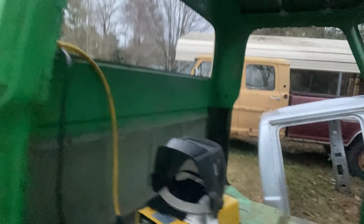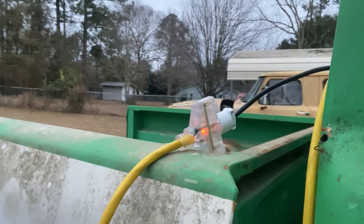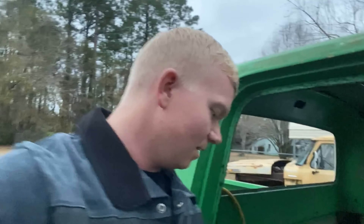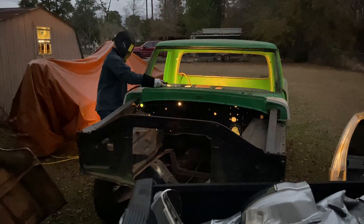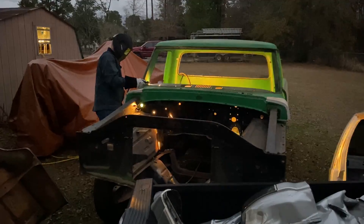I feel like we're in a good spot to start cutting stuff. The dash needs to come out, the firewall, the whole floor — but I do want to be kind of easy on this floor because it is so solid. It definitely has surface rust, but this light's not doing it much justice. This is the only tiny little rust spot I've got, which is a lot better than most of these old floors are. My other donor cab has a couple different ways I could go — I may end up wanting to just take that floor out and put it in. I want to start with the dash either way because it's easy to get to, get it out of the way, and then make it easier to get the firewall out.